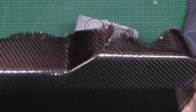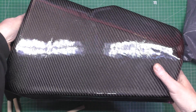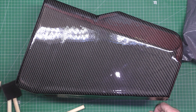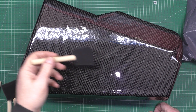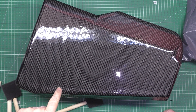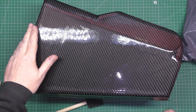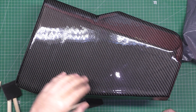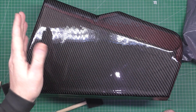I've got to cut it all around on that one as well - a hell of a lot of trimming to do. As everyone knows, carbon fibre is a carcinogen, so you've got to be bloody careful with it. I'm going to have to wear a mask. In places like this where it's lifted - it's only about a millimetre but you can still see it. Carbon fibre doesn't like 90-degree angles. The others are rounded off and I wish I'd known - I would have rounded that off as well.